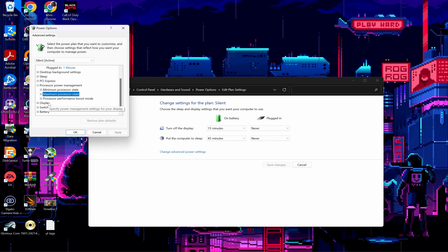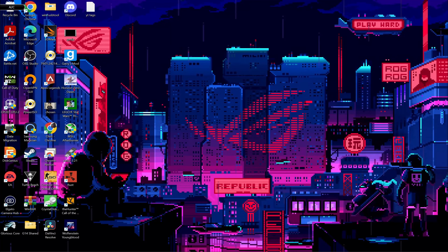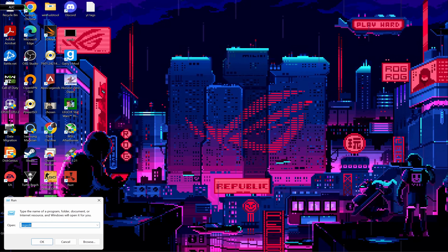The last thing on this page: put your GPU mode into eco mode. However, if it doesn't let you do that, go to the top to the device that has the keyboard and mouse logo, then ROG Zephyrus G14, then go to GPU Power Saving. It will show you a list of processes using your discrete GPU. If there is a list, hit Stop All in order to switch it to eco mode. Make sure there's nothing super important in there and you should be good.